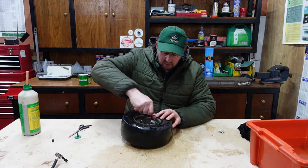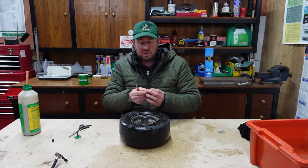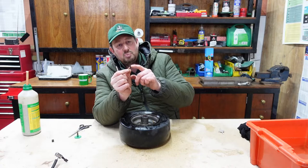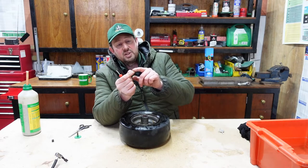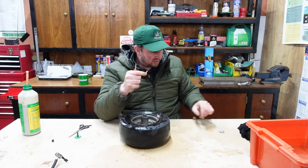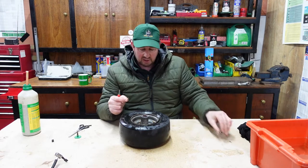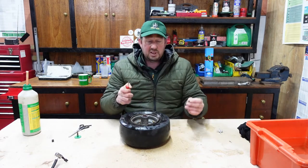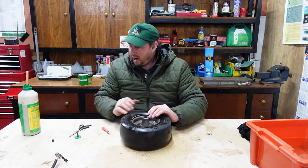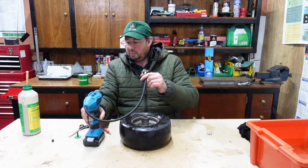When you've tightened it as much as needed, don't over-tighten — there's a good seal on there. We recently switched to valve stems with red seals: you can see dark lines if there's any dirt or cracking, whereas with the old black ones you couldn't tell. With the red ones you can see any contamination clearly. That's back in. All we have to do now is get the mini air compressor and blow it up.